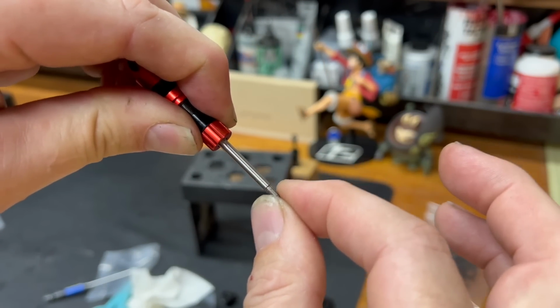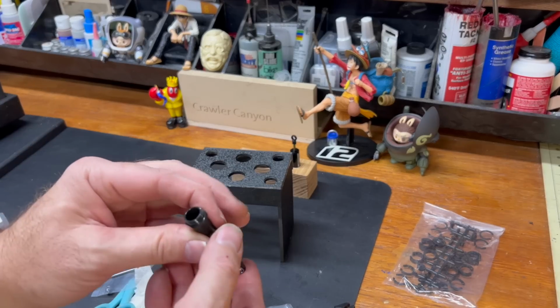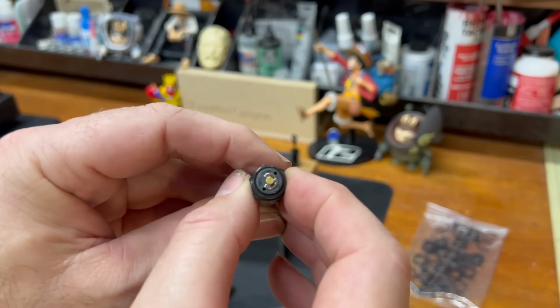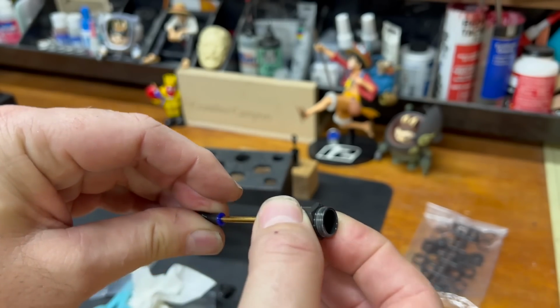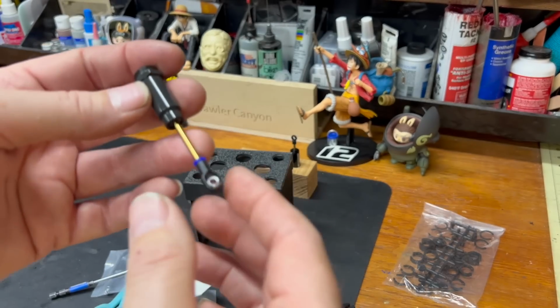That ability to move mostly speaks to the seal pack, but it also speaks to the fact that the relationship between the piston and the body is not close. Like that is good right there. And we get a nitrided shaft. How much of a difference that actually makes, I don't know.